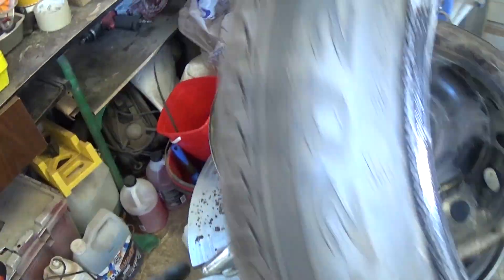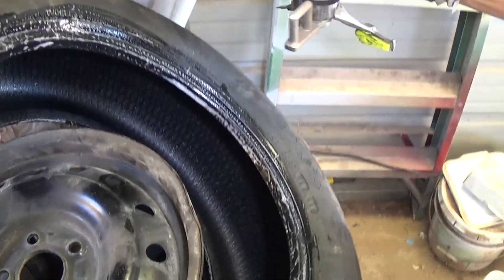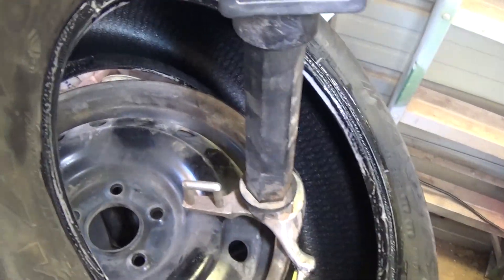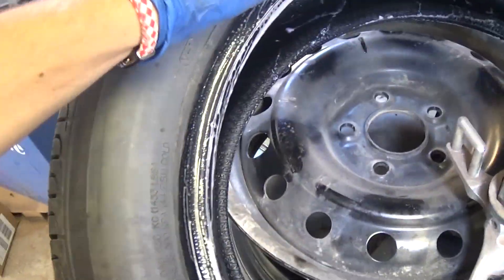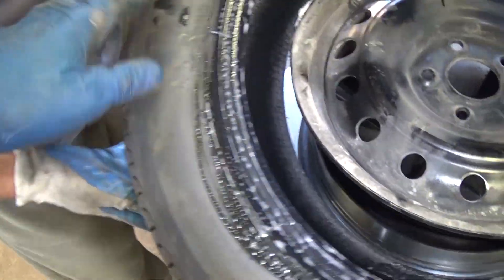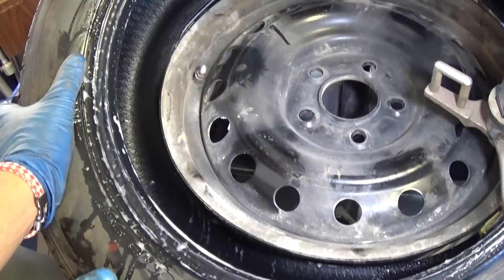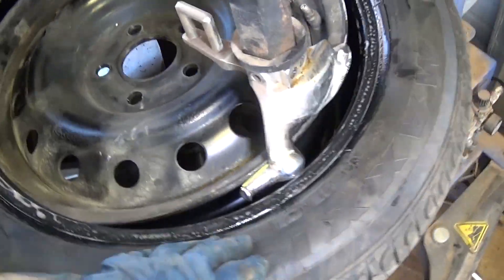Now it's important to position the sensor. Let me show you where the machine is. We're gonna get the arm in, right there, and lock it in place. The sensor needs to be about 120 degrees from me — make sure it's there. With the valve stem right here, for better balancing, you're gonna start right here right before you hit the sensor. We're gonna turn it, and now it's out of the way.